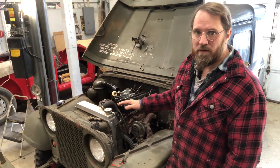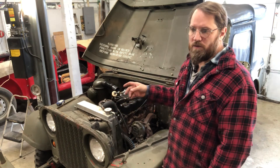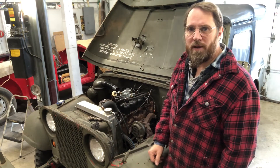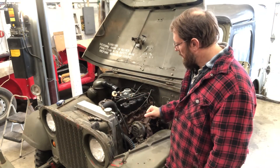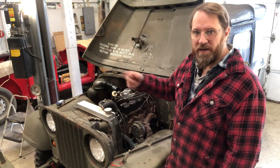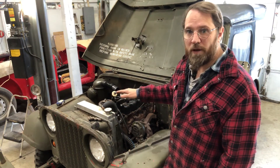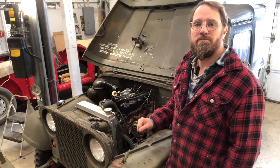Now I know what I'm working with. What I'm hoping is that with as much as it's sat over the last 10 years, I've either got some rings that are gummed up in the piston or some rings that just need time to reseat and seal properly on that one cylinder. I went ahead and put a little bit of penetrating oil down in the cylinder and I'll let that sit. I did get better readings after doing that, but I'll have to run it for a while and check again. Next time you see this thing I'll probably be installing the SU carburetor. This is MG Rob - later.